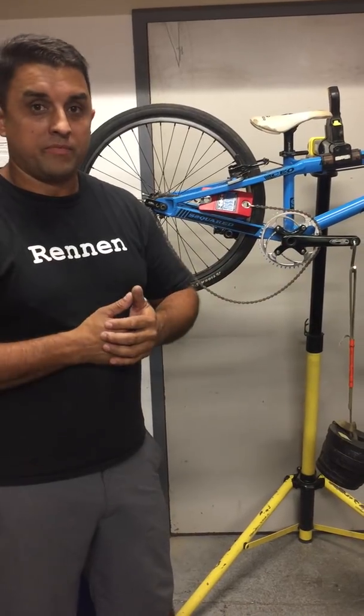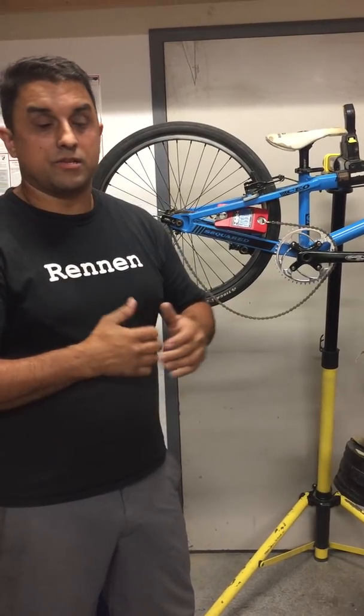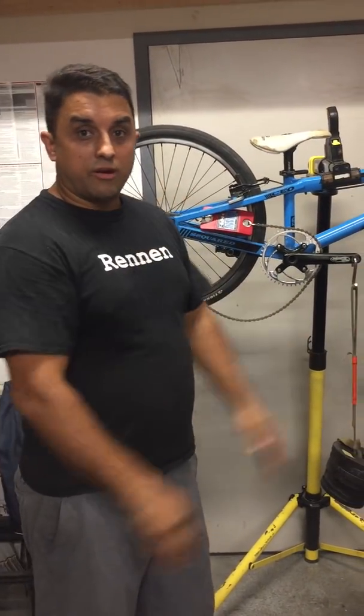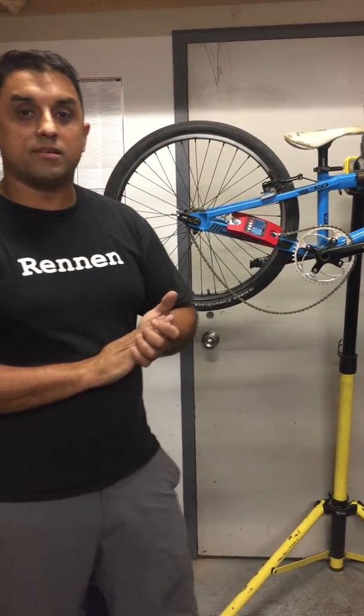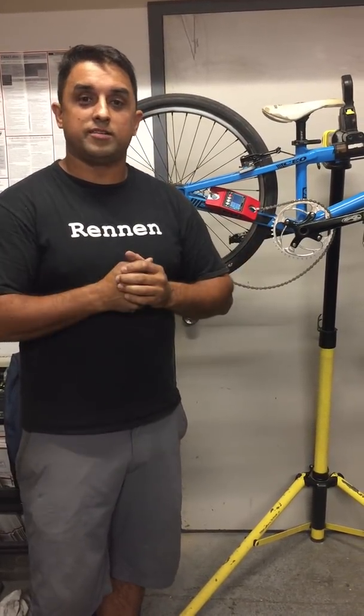This makes sense because it's a bigger gear — a bigger gear ratio. You can think of it like starting your car in first gear versus fifth: the 44.2 is like starting in fifth, the 43.7 is like starting in first. The lower the gear ratio, the more force you can produce on the chain — it helps you get out of the gate better and accelerate faster. This all came about because of a video that was put out a few weeks ago. This is just part one — I'm going to make a part two breaking down that video, the errors and flaws in it, and some of the motivation behind it. Hopefully this explains everything, and if you have any questions feel free to contact me. Thank you.